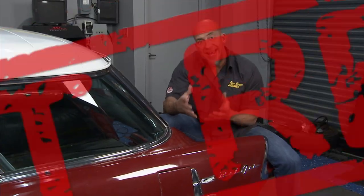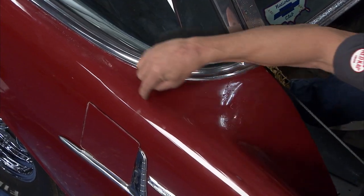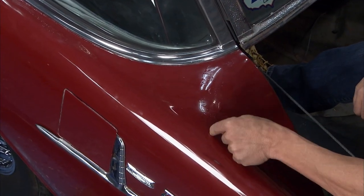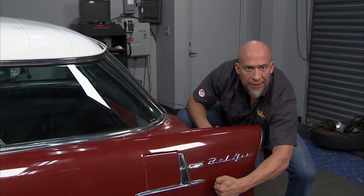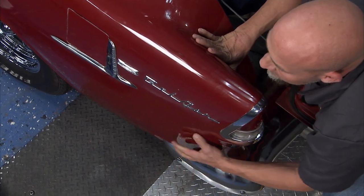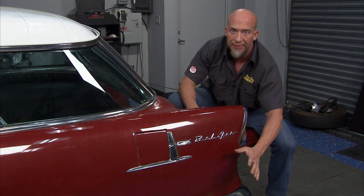Okay, kind of alluding to what Kevin was saying, at the front of the car, you see signs the very same in the back, either an impact or a lot of rust and somebody did a repatch. Now here you see a weld or some sort of seam coming through, another seam right here. If you do the old knock test for Bondo, you can hear that's metal, but you get down in here and you start feeling a lot of Bondo. You can detect that just by a simple big difference there.